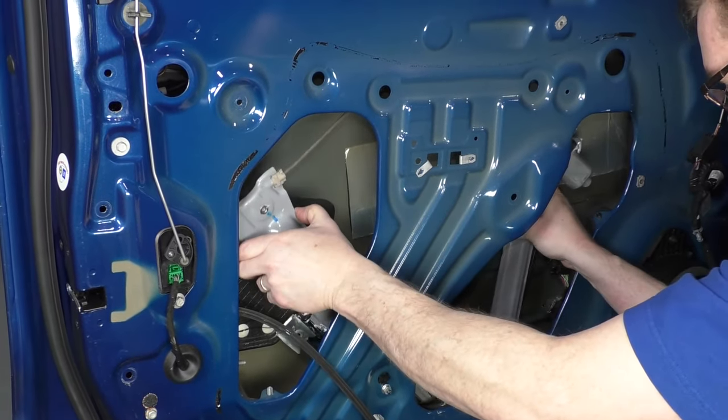Now this inner trim piece — you basically want to get this lip in first, so start it on. Push with your thumb on the inside first to make sure everything locks into place, and then up here, just make sure that pushes in and locks. Push it down and make sure it goes underneath this weather strip. Push this pin into place and this pin as well. This weather strip should really be outside of the bolting, so you may just have to work it with your fingers up and around.